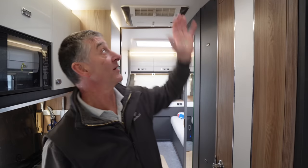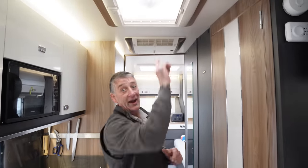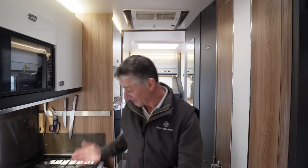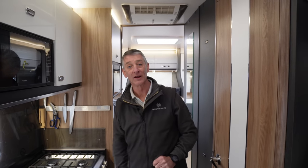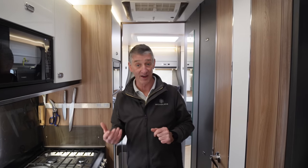All vehicles come with fixed ventilation points — things like roof vents on the outside, high-level vents, and floor-level vents. The floor-level ones are more specifically gas drop holes, fitted underneath items like your oven so that any escaping gas can exit the vehicle in the event of a leak. It's really important that these ventilation points are kept free to maintain proper airflow.